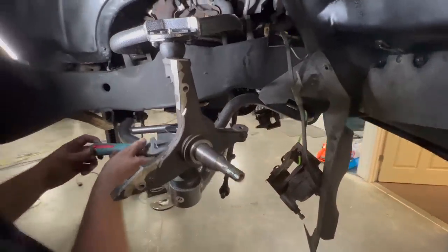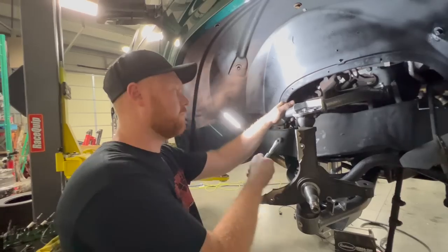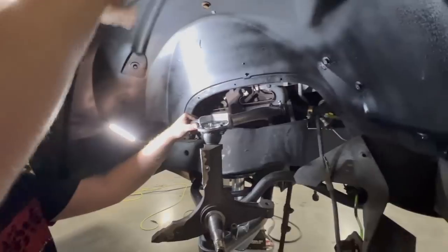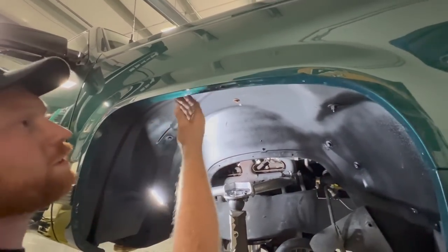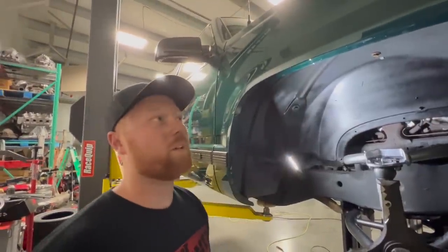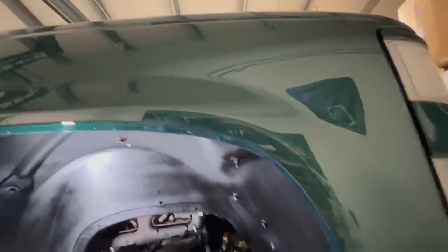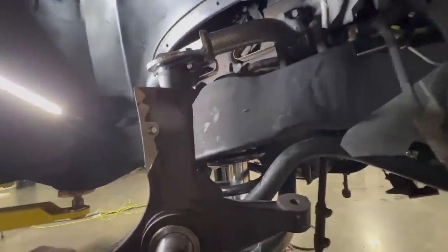Can't wait to see the front end on the ground. Yeah, I can't either. It's going to look nice. If it looks like the back, we're in business. We'll get it right where we want. These are easy to roll, though. You can literally get a rubber mallet and just hit these. Yeah, the fender roller only gets a little bit because it's square. So you just kind of massage it. That double wall right here, it just bends up nice. And this factory paint rolls with it. It doesn't really crack. It's nice paint, at least from the other truck's experience. No, it'll be good. Cool.